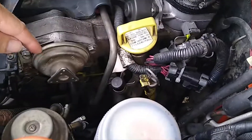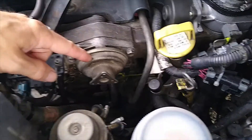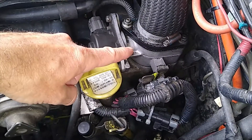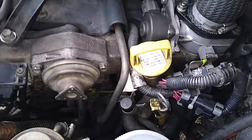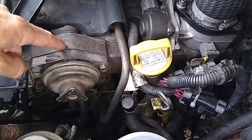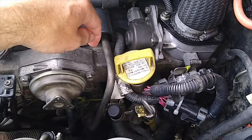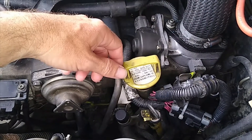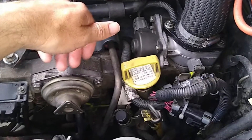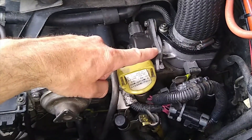There are possibly a couple of downsides of just disconnecting this. I've noticed and I'm pretty sure that this truck runs a little bit rich at idle. And that has to do with the throttle body over here closing up. The function of this guy here is it's got a plate which shuts and creates a slightly higher vacuum in here, and allows it, when the EGR valve is open, to pull exhaust gas into here more effectively. But by blocking the EGR off, when this plate shuts, it actually starves it for air a little bit more, so you're not getting a full burn of fuel. I think that's why this truck idles a little bit rich — it's a little bit stinky. But I've run it like this for eleven years, and it idles fine, doesn't hunt or cause any issues, and that's with the throttle plate still in there.